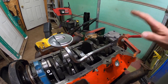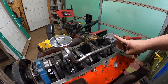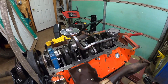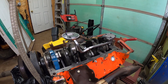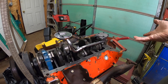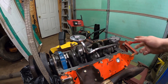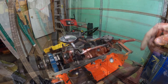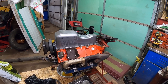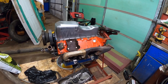Got it all lined up and dialed in — working good. Took a little bit to get it pounded on there; I took it off and put it in the vise. So that's the conversion if you don't want to drill and tap that hole and risk getting dirt or shavings inside. I'm going to use the four-piece gasket, dab some silicone in all areas, and hope for the best. Got the new oil pump all on there, so now it's a front sump — looks a little weird, but that's what needs to fit into the 49 shoebox.